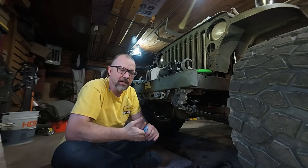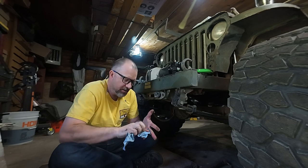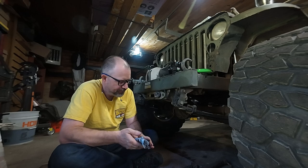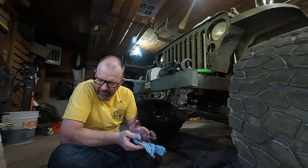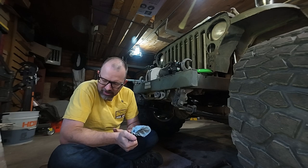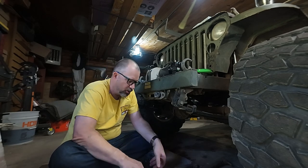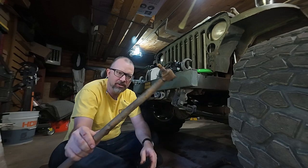So these are 1-ton tie rods, whatever, make it bigger, stronger, yada, yada, yada. And you can. But my data point on it is that these are or were factory, at the lower end of aftermarket tie rod ends for a CJ5, CJ7, stock stuff. Where they're configured in the stock might be a little bit different, but basically it's the short tie rod end, left and right threaded.